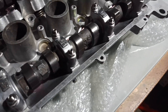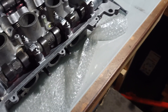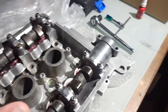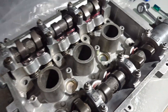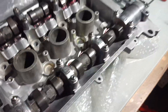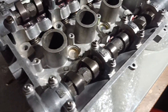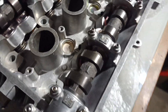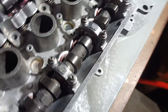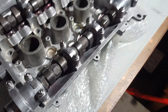Whatever you do, don't set the valve clearances to what it says in the workshop manual when it's cold on the bench — you want a very happy engine top end. As it heats up, that valve clearance will get even higher. So it's just a case of ordering these new shims; I expect they'll cost about 30 to 40 pounds to buy all six. Can't do anything about that — I just need to get the correct size.